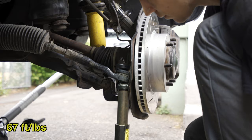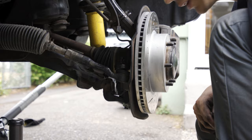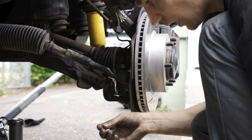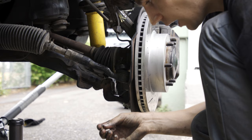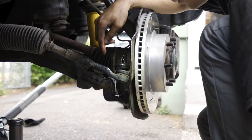The outer tie rod gets torqued to 67 foot-pounds. The only way I was able to tighten it was with the impact — if I was using anything else like a hand tool it was just spinning. So try to use your impact or some type of power tool. I do think we need new cotter pins — the kit didn't come with any for this piece, so I'll need to pick some up at some point.